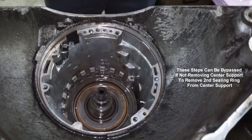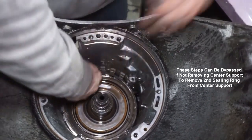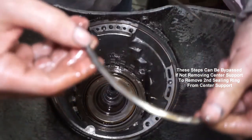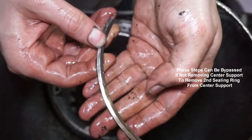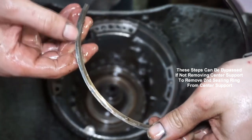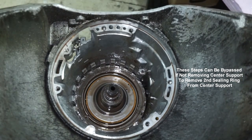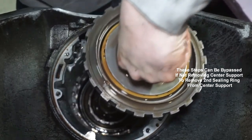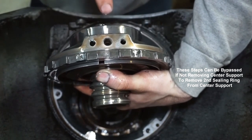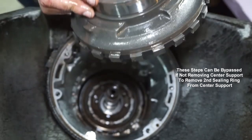And now we have another snap ring — it's going to be a little tricky. I like the center support snap ring. This one actually has a beveled edge on it. The top is beveled, this is flat on the bottom — this is going to be your center support snap ring. So now this whole center support section, be able to grab it and just yank it out. See those three holes right there — these are lubrication holes, fluid holes. That is the bolt that I pulled out before. If you don't take that bolt out, you're not going to be able to get the center support out.